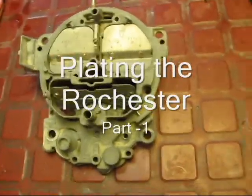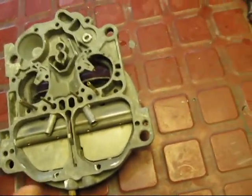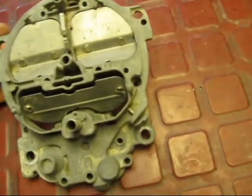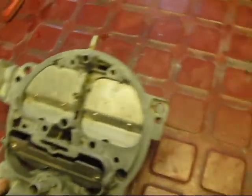Here's an example of one of the carbs I had running. This one basically runs, so I took it apart. I'm going to clean it and re-plate it. This is the top for the carburetor. What I did was hit it with some aircraft stripper, just rinse it off in a degreaser, and you can see it leaves a little bit of schmutz.